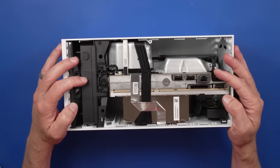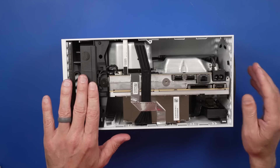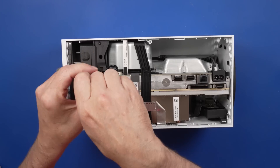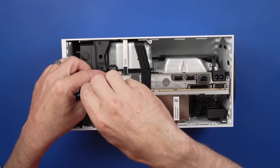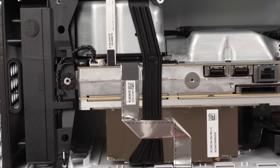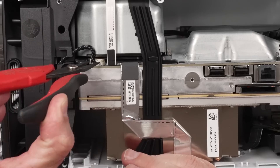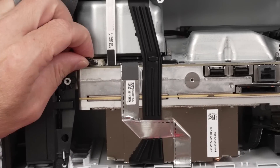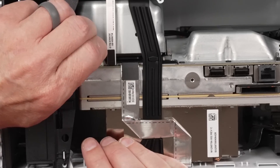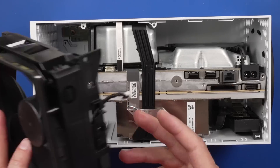One of the things I want to find out while we're doing this teardown is what parts from the previous models fit this model. I'm going to first try the fan to see if the fan from the previous model will fit this one. To remove the fan, we have this screw, a screw here, and a screw here. I'll use needle nose pliers to remove the fan connector — actually, I'll just use my fingers and wiggle back and forth as I pull out. There we go, and the fan comes right out.